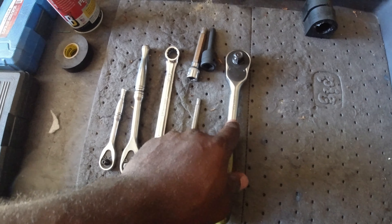Once you get it off, there's an extension right here for the bolt — you have to tap it out to get clearance so you can move the bar freely. The best way to do it without damaging anything is to make sure the triple square is in there properly, then gently tap it. You don't have to hit it all the way through, just tap it and it will push through. Grab a light mallet and just tap it through.